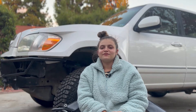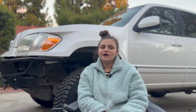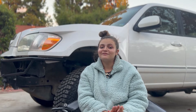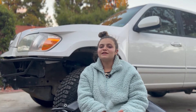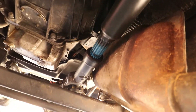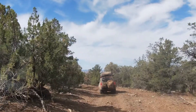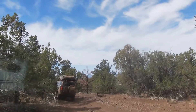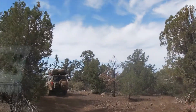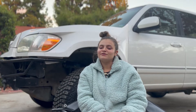The fourth modification is the front driveshaft. Due to the heat from the catalytic converter and the steep angle from the car being lifted, the driveshaft can experience a lot of stress. The stock factory units are known to go kaboom while ripping everything in their path, so you could say goodbye to your exhaust and transmission if the driveshaft ever decides to quit. This is just another reason to do the upgrade and purchase a greasable one from Tom Woods or other trusted manufacturers. These upgrades don't last too long and we actually went through a few driveshafts during our time with the discoveries. We experienced squeaking and vibration at times even with the greasable one, so just be sure to stay on top of maintenance with the driveshafts. Replacing a driveshaft is straightforward and with a few bolts you'll have the new one installed — I've never done it myself but I've seen David do it like 10 times and it seems pretty easy. Just be sure the exhaust is cool before you go under there because you will get burned.